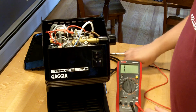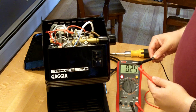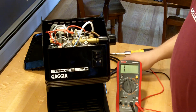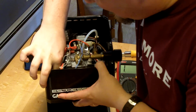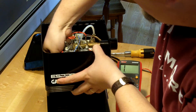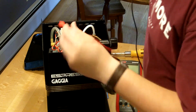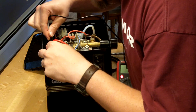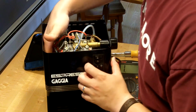We can test them with a simple basic multimeter — this one's digital, but anything will work. It has a continuity function where it'll beep and give a reading if there's a circuit. The first thing I want to test is the thermostat, backing these clips off a little bit so I can get a probe in. Polarity shouldn't matter here, so I'm probing one side of the thermostat, then the other — and I get continuity. That suggests my brew thermostat is fine and that's not our problem.